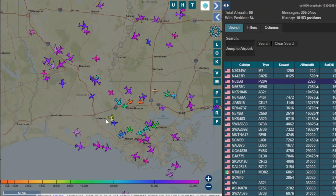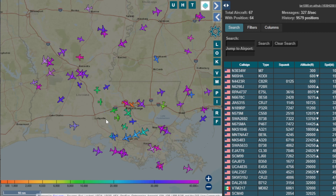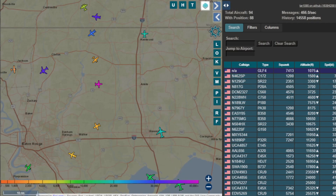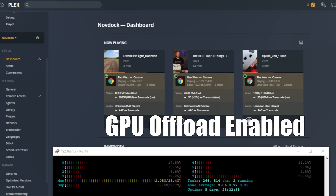After the hands-on recording, I did put Docker Compose on it following a little guide, because I want to consolidate some things with my ADS-B setup — which is actually doing the tracking of airplane beacons, and no, it's not in a bad way. I have it in testing with just the antenna. I also put the Plex container on it to test GPU offloading since I don't have that on my Unraid box. It works pretty well — I ran some 4K decoding through it and it keeps CPU usage way down. Eventually I may push Home Assistant over to it as well.